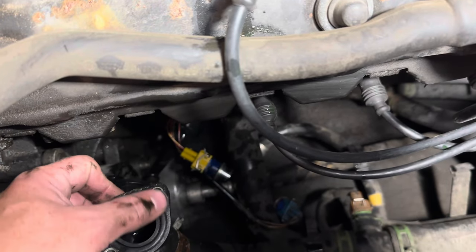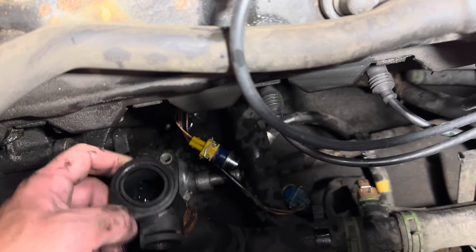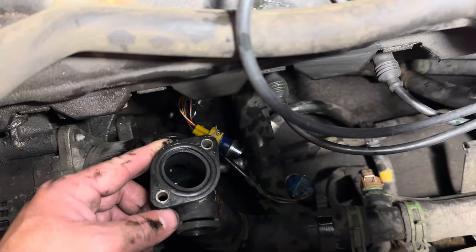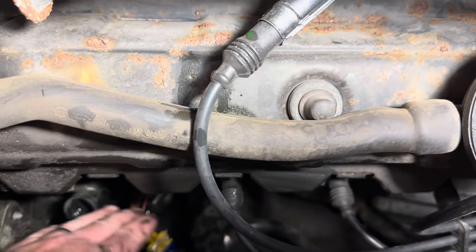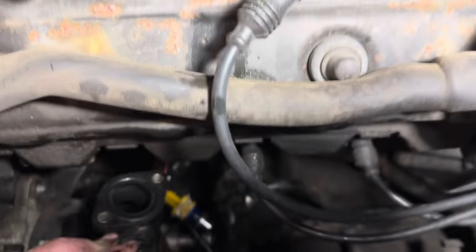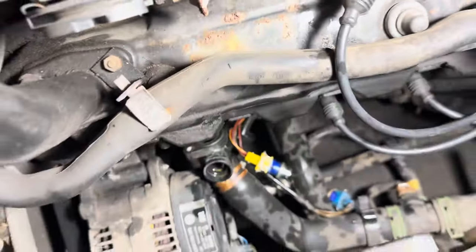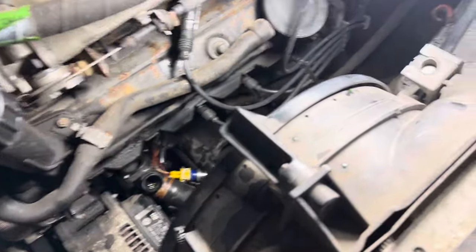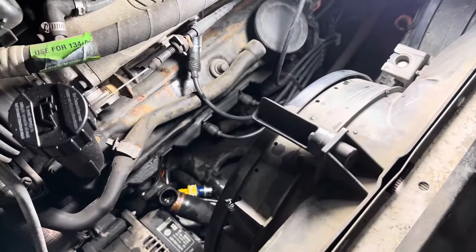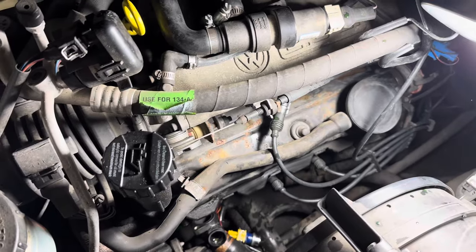Just make sure that the O-ring has antifreeze put on it before installing, just to make sure it's not dry when it goes in. Also make sure to take your time and clean up the surface between this unit and the engine, just so it gets a good seal. Really easy, a ton of room. People talk about these Eurovans like there's not enough space to work on them, but when in reality you just shift this whole core forward and the five cylinders are right in your face.